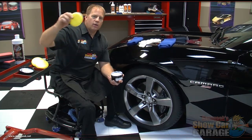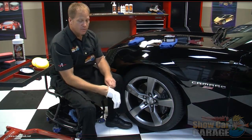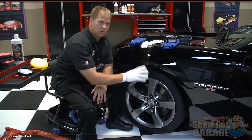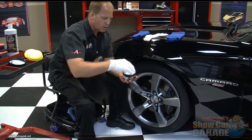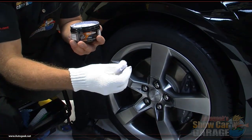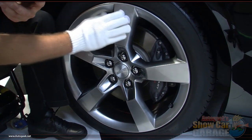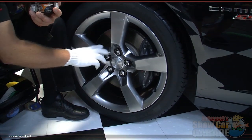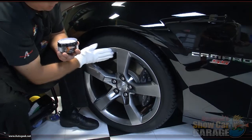You could apply this with a little yellow applicator like you would put wax on a car, but let me show you something cool — this is a microfiber glove. Microfiber is soft and gentle, and if you look closely at these rims, they have a high gloss smooth finish, so you never want to touch them with anything that might scratch. Take your fingers, reach into the wheel glaze, grab some wax, and before you put it on, rub it into the glove a little bit to pre-wet it. Then come down and just start to put this on just like you would put lotion on your face — rub it in, because your fingers can separate out to get into intricate areas. Just gently rub the product in and leave a nice thin coating, then let that coating dry to a light haze.